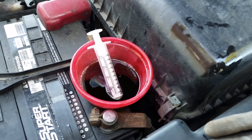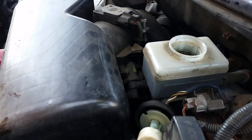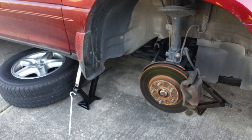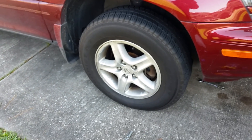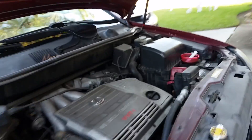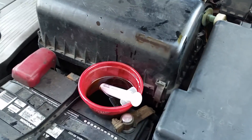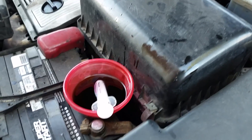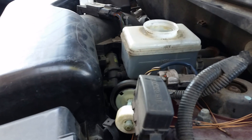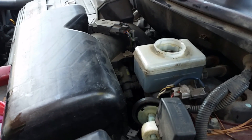I got the piston back. I had to pull some fluid out just in case. After I change the other pad I'm gonna pump the brakes and see if the level needs more or is good. Second tire is done. Now it's time to check the level — see how much oil I subtracted from the reservoir as I was pushing the pistons. The oil I had added throughout the months was trying to compensate for the wear. It looks sort of good; I want to put a little bit back, cover the system, and then pump the pedals and see what happens.